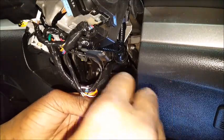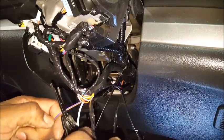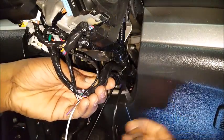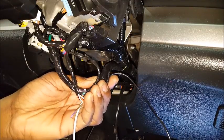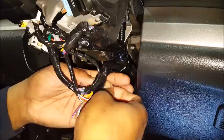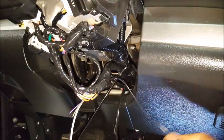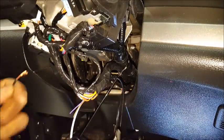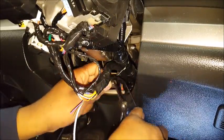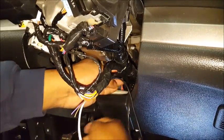As soon as I ground the remote start, that noise will go right away. These I don't need — just clip them off. This I can just fold back. If you ever hear a siren going off very low like that, that means you have a background noise issue.